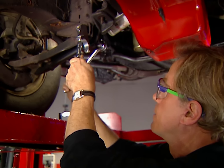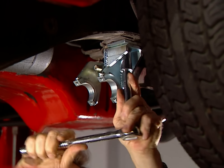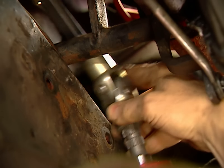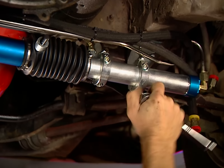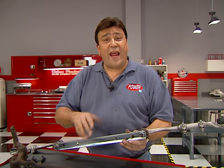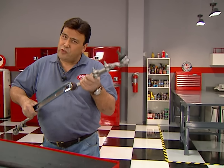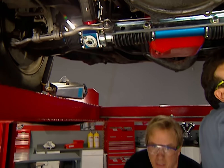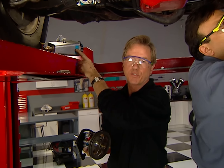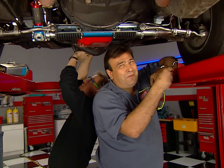After removing the inner mounting brackets from the rack assembly, bolt them to the control arm mounting points. The outer bracket bolts up to the frame. Install the rack assembly loosely to the mounts, then install the intermediate shaft to the column and attach it to the rack. Tighten the rack to the mounts. I've removed the center link from the rack so I can install the tie rod ends using the special adapter included with the kit — if your tie rod ends are worn, be sure you replace them first. The pump mounts to the engine block using the included bracket. Then just add a new belt, hook up the hoses, and install the reservoir in the engine compartment. Don't forget, you'll also have to take your Mustang into a front-end shop for an alignment to take full benefit of this new steering gear.